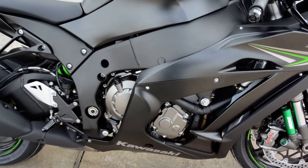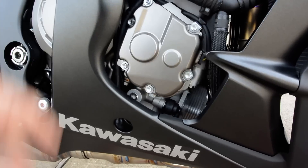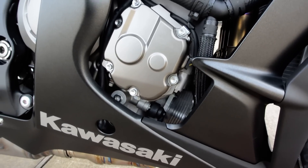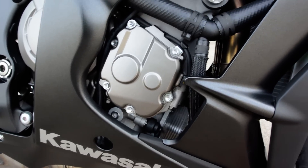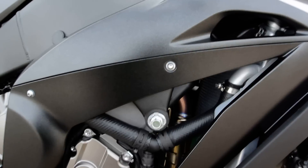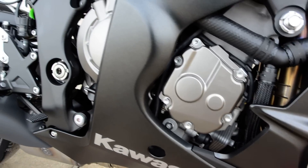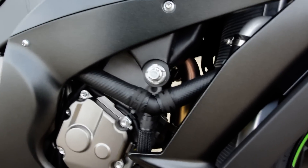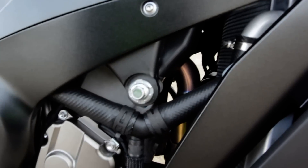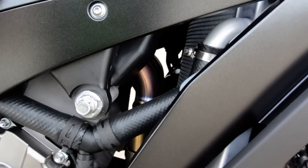Motor-wise, what did they do? What didn't they do? The crankshaft is now about a pound lighter than before. They also lightened up the countershaft and the counterbalancer shaft, and increased the mass on the flywheel a little bit. Bigger, straighter intake ports, lighter camshafts — the camshafts are now forged chromoly steel billet, as opposed to cast, making them lighter and stronger, about half a pound lighter. New long-reach spark plugs let them add more of a water jacket on top of the head for better cooling. And the exhaust is a titanium alloy, as opposed to pure titanium.